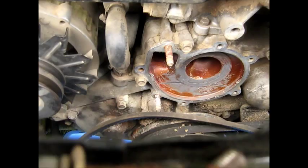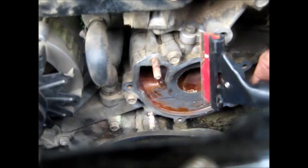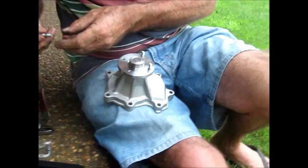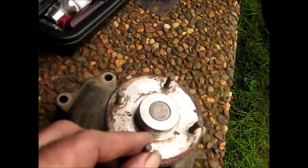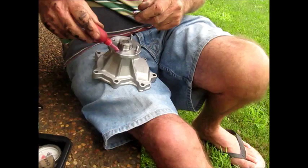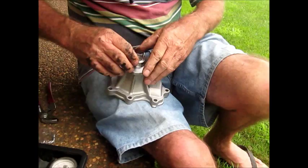So we've just cleaned the old gasket off the water pump — use a razor blade if you can, just scrape all the old gasket off. We've got the new pump over here. We're putting the new bolt studs in — that's the old studs there. We've got the new pump and we're putting the studs in with the short thread going in first, long thread out, tighten that down as far as it can go.